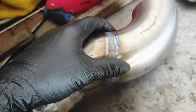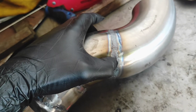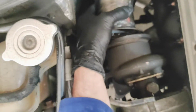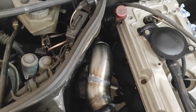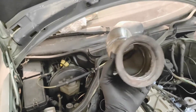Because these are mandrel bent, the ends aren't perfectly circular meeting each other, so there was a lip. You end up heating one side and stepping the filler down to bring it onto the other. Let me bring this over — so sitting it there, it looks something like that, and then that'll bring me straight down out through that gap. It's quite a pretty downpipe — has a nice shape to it.